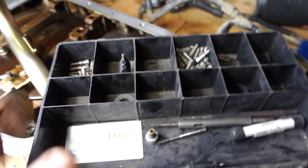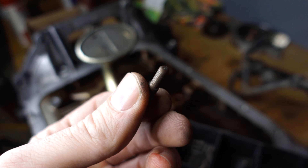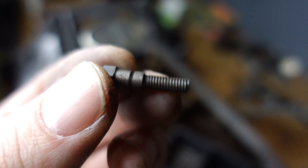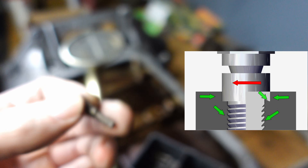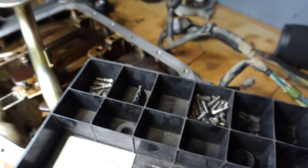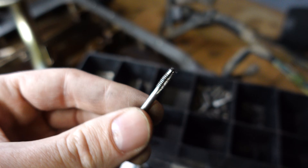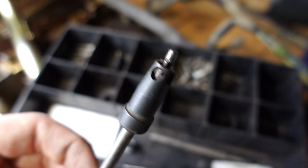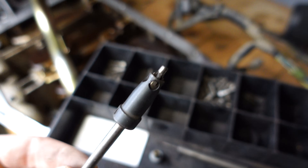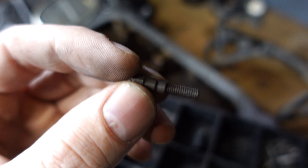My local machine shop lent me this used lock and stitch kit. The way it works is they have these stitching pins — this is a proprietary design with a special hook on the thread, so they're kind of angled upwards. This whole kit is basically to get these pins installed on the block. They're going to stitch the sides of that crack together and prevent it from spreading any further. It comes with special taps for those threads, and a spot facing tool that gives it a countersink or counterbore, which allows the shoulder of this pin to sit in there properly, adding strength.